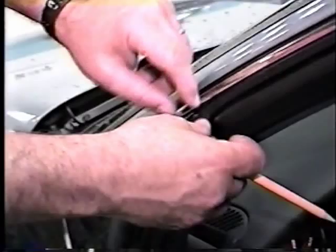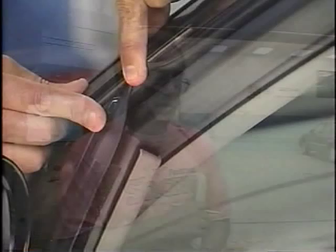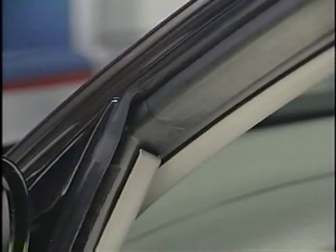Okay, now this noise, does it manifest itself as kind of a whistle, or is it kind of a little droning? It sounds like you're frying eggs, like a little sizzle. Like a sizzle, okay. All right. Try placing a piece of foam tape behind the channel to build it up so that it seals properly. If you can't get a good seal that way, replace the run channel.